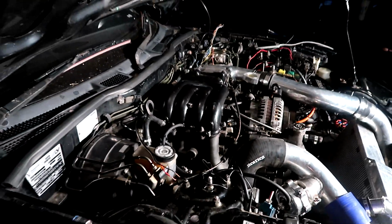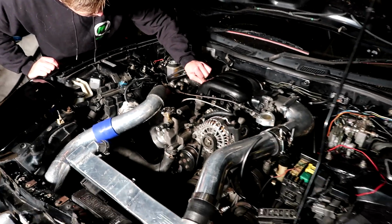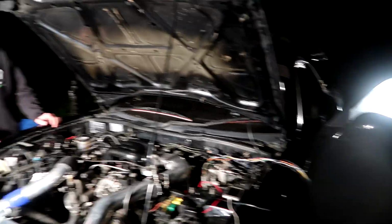Anyway, Mr. Ground Zero's done a pretty tidy job there. Well done. Thanks. And Josh has got the wastegate on now. Is it on? She's all snug down there, can't really see it, but the downpipe's on. Exhaust is on, still got to make up the screen. Got the oil feed on there, zip ties over the way, oil drain from the turbo's on. About ready to go.